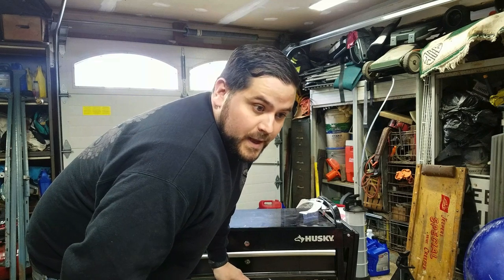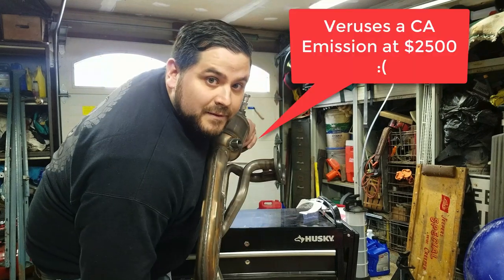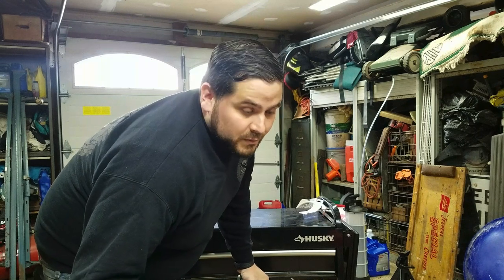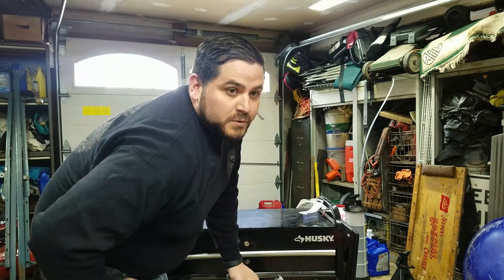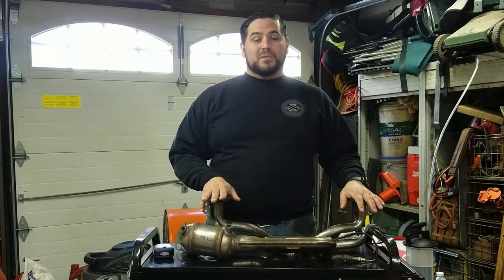But I have one. The federal emissions, which is a 49-state legal catalytic converter, is $213 — this guy right here. So this is the whole purpose of this video: seeing if we can beat California emissions, number one. And number two, if you have a bad catalytic converter and it doesn't rattle, flows fine, no surging, no exhaust clogging problems, you can do this to bypass the P0420 code, which is catalyst efficiency below threshold bank 1.